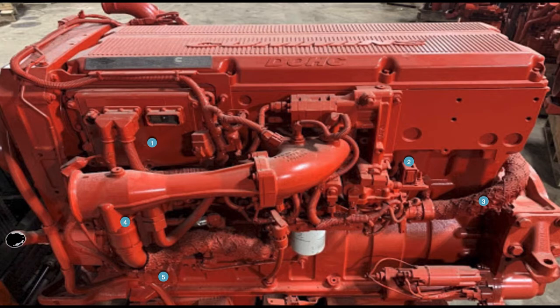Number two, towards the back of the engine halfway down, is the EGR differential pressure sensor. It has two small lines — what look like brake lines — that hook from the mounting pad to the EGR pipe. Inside the pipe there's a block of steel welded with a hole in it, so when air flows over it, it causes a bit of a vacuum. That's how they measure the flow of EGR going into the intake.